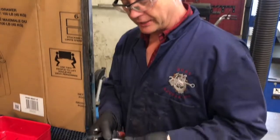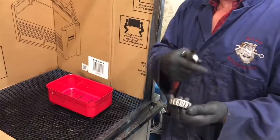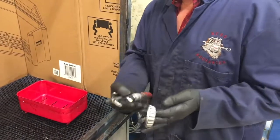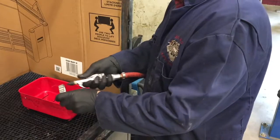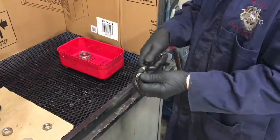We're over at the ventilation booth. We're going to take our bearings and blow through them to clean off any residue of solvent or water-based cleaner. When blowing off a bearing, blow through the bearing — do not let it rotate because it can cause a safety issue. Rollers can come out and the bearing can spin at 20,000 RPM. Those rollers could come out and seriously injure or blind you. Blow through the bearing completely until it's dry, then blow off the remaining parts as well.